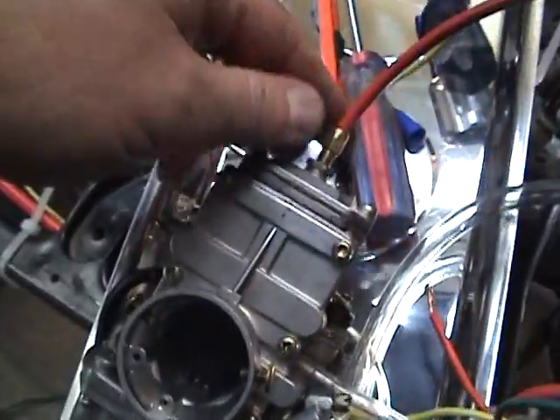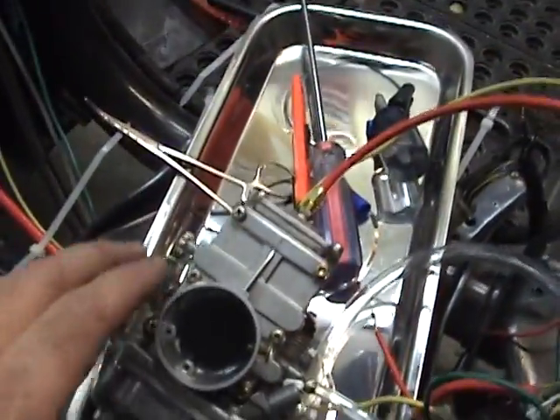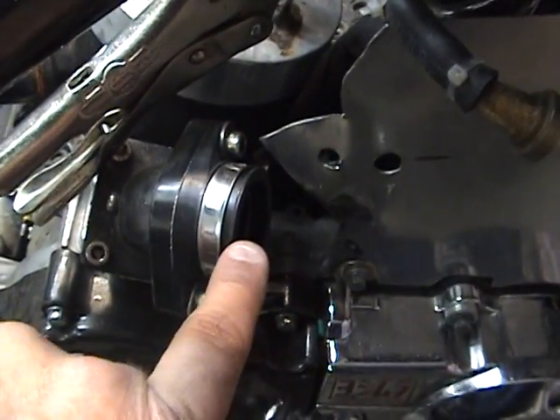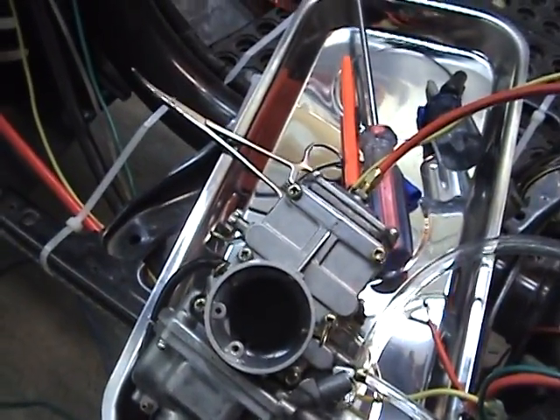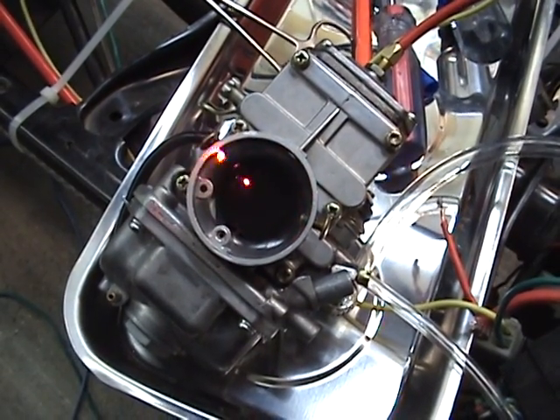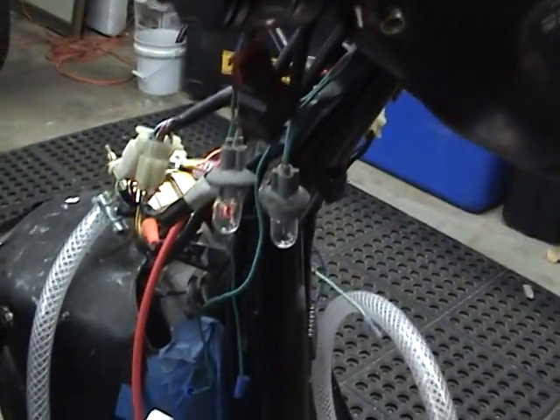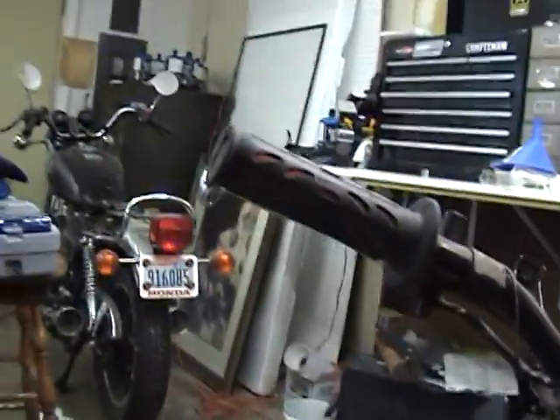You do that by adjusting your cable here, or here, or right up at the top there. Even if the cable is sitting right here the way it is, it's not where it should be. Even if I go to put the carburetor back on the intake, the cable could stretch or change, and that can change the dynamics of the slide. So after I get the carburetor on, I'll have somebody pull the throttle wide open and make sure that nothing has changed. Then I'll make sure there are no obstructions on the throttle cable all the way up when I twist the handlebars back and forth.